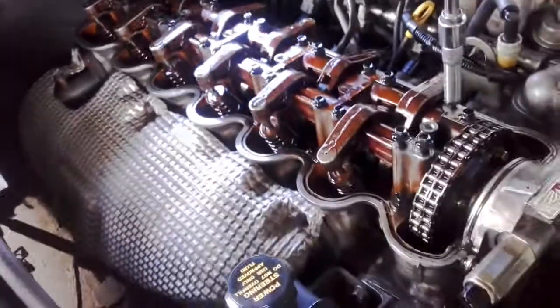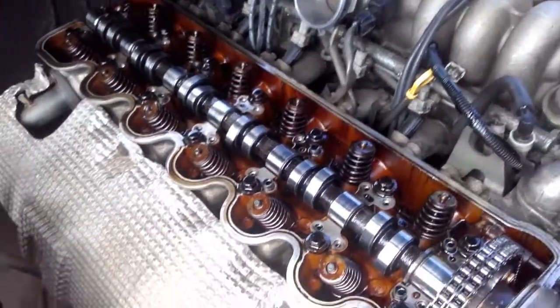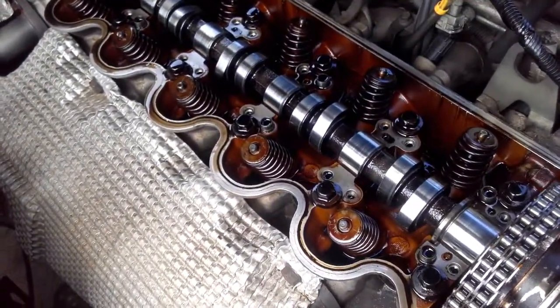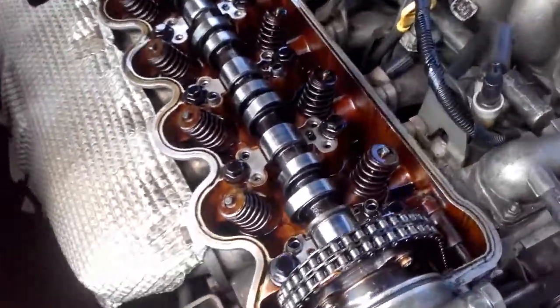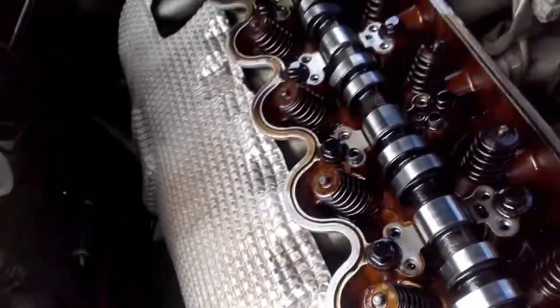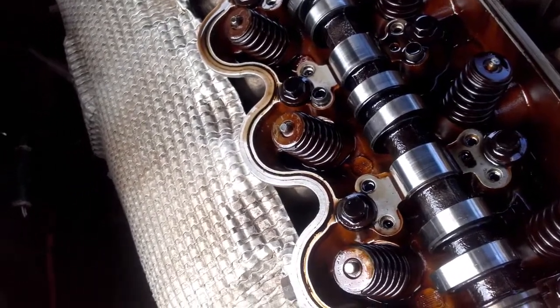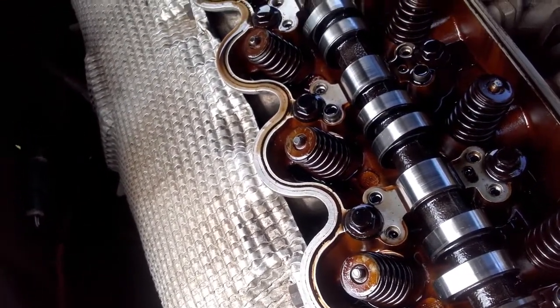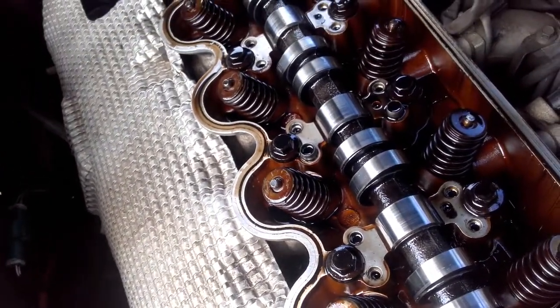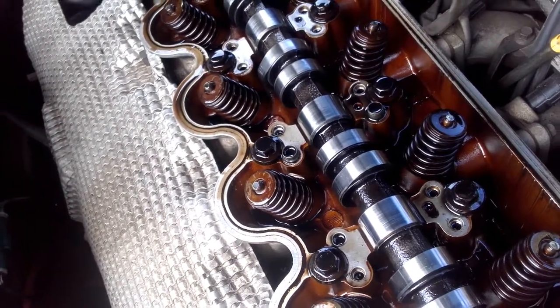Alright guys, let's take this valve train off. We've got the valve train assembly off — we had a little accident: down there is a shim and down there is a shim. I should have known better because I've got stacked shims. You could always put a rag down your oil galleries to prevent that from happening, because the lifters are barely sitting in there with their little ceramic o-ring at the end of them.